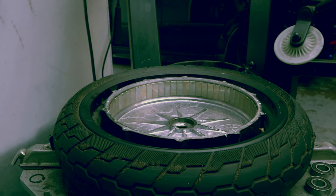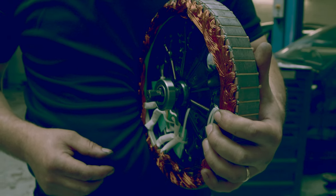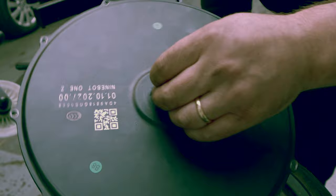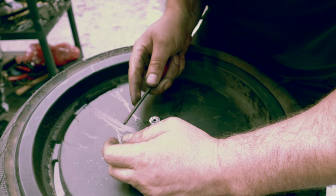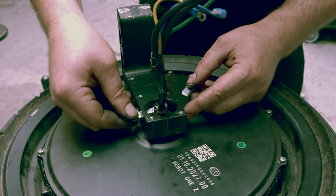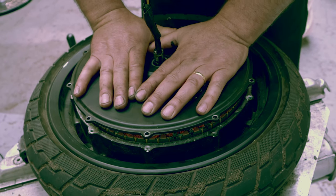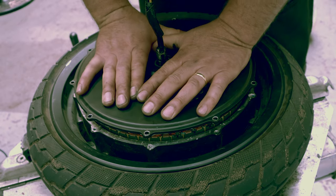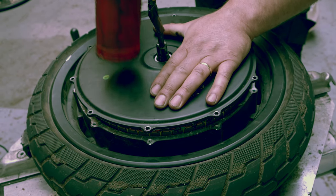When we talk about electric unicycles, the majority of them only let you open one side of the motor, and that becomes a problem. When you arrive there, inside your motor you have magnets all around. Just taking out the top part of the motor is really hard because the magnets are so strong that that part doesn't want to open — and to open it I basically damaged it a bit, to be completely honest. I recommend you to find someone who can really help you. When you try to open the motor you have cables coming from the top, and there is a specific tool with three legs you can attach to slowly lift the top, but in this case it's impossible because of those cables coming through. You need a specific tool to detach the top part while managing the cables in the middle.